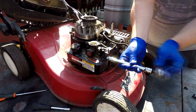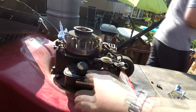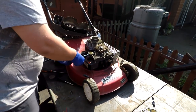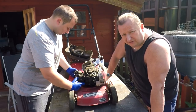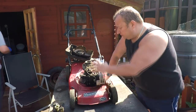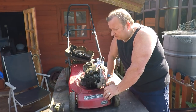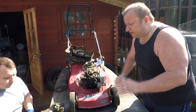I'm going to take the fuel tank off now as we always do - that's with a 10mm or 3/8 bolt at the front, and around here you've also got the half inch or 13mm. Bank Holiday Monday and we're just doing this to help someone out, because that's the sort of people we are. Anyone can really learn these - they are learnable skills. If you want a hobby or to earn some extra money, start repairing these little lawnmowers. These are probably the most common ones. The ones to go for are these little Briggs & Stratton ones.